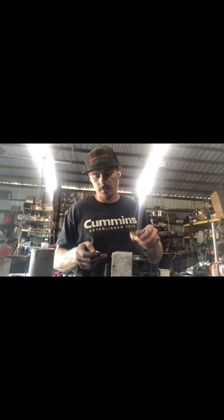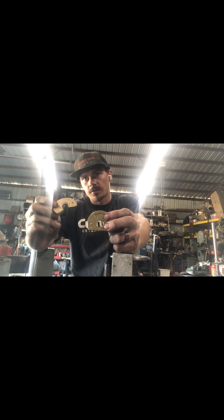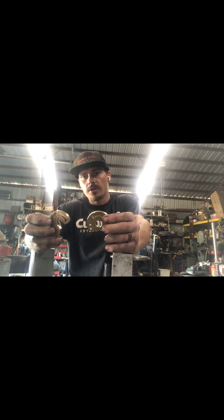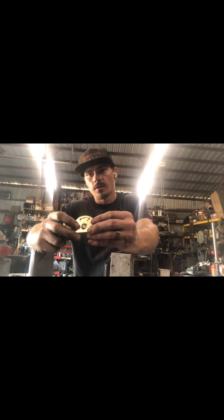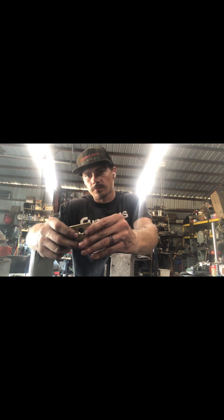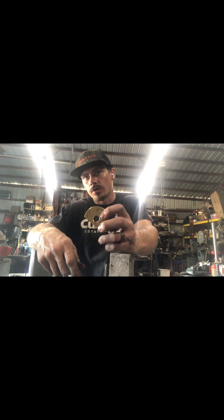It's going to get a 360 thrust put in this. Diesel applications should all have this one. This is what all SX3s come with, and older S1s — just bigger. This is a 270, this is a 360. Why the bigger thrust? The supporting thing is deflection. These are supported on the outside — on the bottom, all the way to this ring, and on the top, on the outer ring. If you get enough drive pressure, what can happen is it will deflect upwards, and when it deflects upwards, the way these work no longer works — it will lose the oil shear and cause the collar to contact.